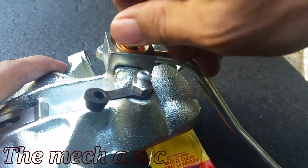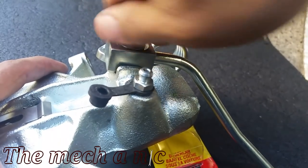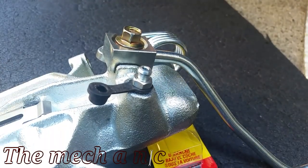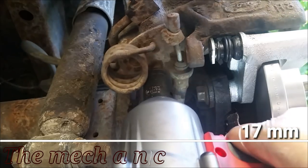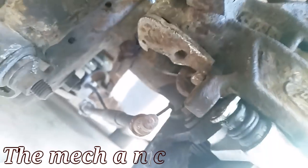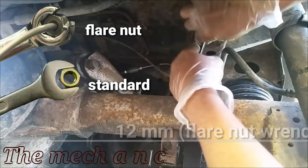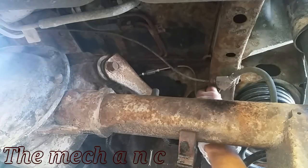I test-fitted it and it fit great — I was able to torque it down to spec without any problems at all. Taking off one fastener right here makes easy work of moving the emergency brake cable off the caliper. If you ever have to remove any brake lines, I highly suggest using a flare nut wrench. If you try using a standard wrench, you're going to round off the nut.